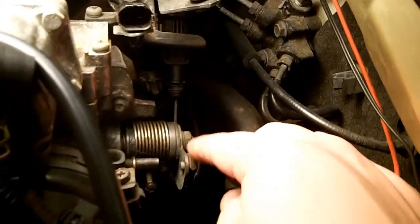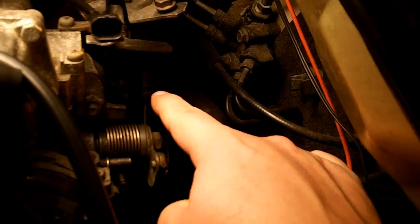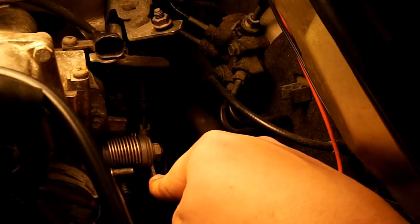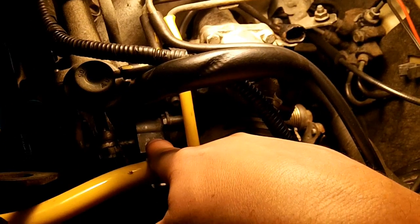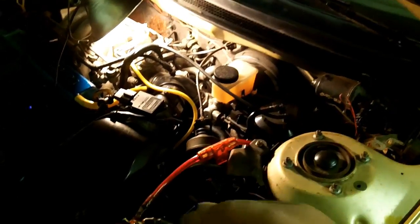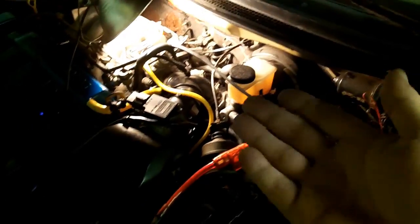This is your throttle right here, and that's your throttle cable that goes up from your accelerator pedal. So when you press on the gas pedal, it actually pulls this cable, and that is what depresses your throttle and opens your butterfly valve. That throttle angle is sent from the throttle position sensor to the ECU or the computer, also known as an ECM, an ECU, also known as a PCM, powertrain control module, engine control unit, or engine control management system, ECMS sometimes.